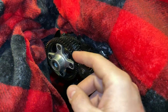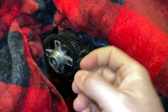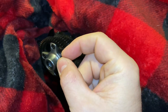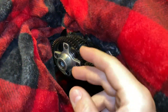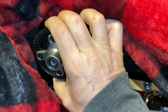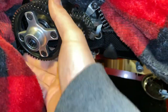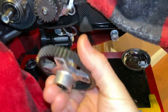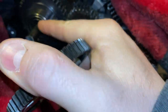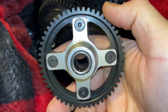A lot of people go through those springs so quickly because they over-tighten them. A lot of times when they adjust their two-speed they actually squish them too much and then they're junk. You want to go a little bit at a time. If you're new to it you're not going to get that feel right away. Now let's take this out. Check your bearings in your two-speed - make sure they're good. The one-way bearings are in this piece here that we're going to be taking out.